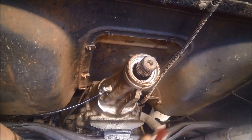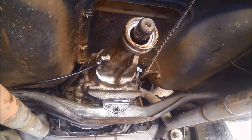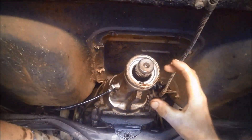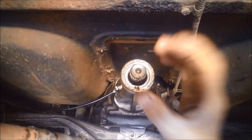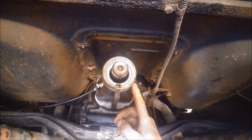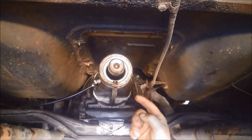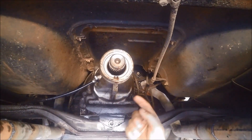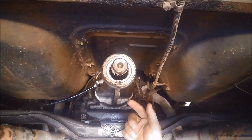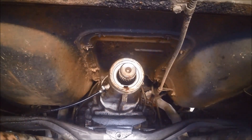You can't really see it but the rubber has hardened as well — flattened out and hardened. Now we're just going to pull that extension housing bush out. We've got a special tool where we put it in there and use a slide hammer to slide it out, and we don't have to take the extension housing off. When you're pushing the new bush in, take note — there are little grooves that are supposed to line up with the little hole in the extension housing, and that will allow a little bit of oil to lubricate the bush.